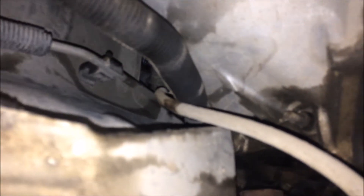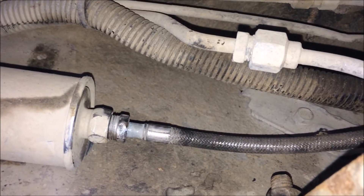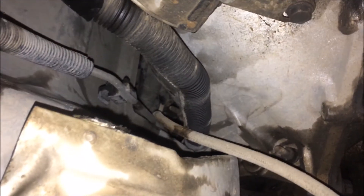That's looking good up here. I haven't secured it yet — it's just kind of chilling. This is all looking good so far, replaced all the way down here to the fuel filter, this is all looking good. Now I have to go pick up some zip ties and secure it all the way so it's not rubbing on stuff — anything of the sort that can damage the braided line over time.